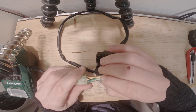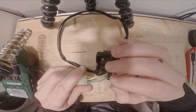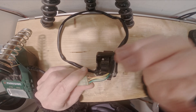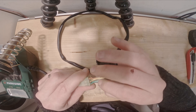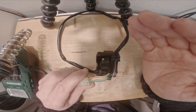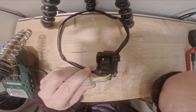For example, if a short circuit happens on the throttle line and it tells the ECU to put the throttle to maximum, the ECU will detect that the voltages between the two lines don't match and will go into limp mode, preventing the bike from running at full speed.